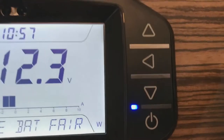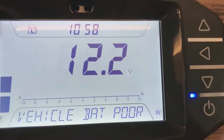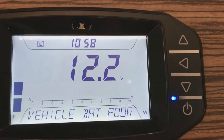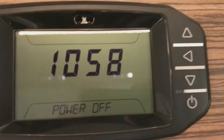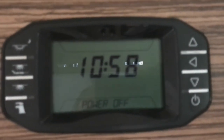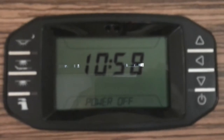You can select this switch here — move it down and you can check the condition of the vehicle battery, which is poor at the moment with 12.2 volts available. To switch off the system simply press the button and it goes off. Just remember that every time you switch off the engine it will also switch off the control panel, so after running the engine you will need to press the control panel back on to power up the systems.